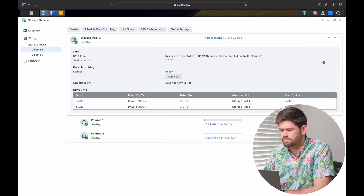Now let's say I'm a bad actor with physical access to the NAS. I've stolen it — I've broken in and walked away with it. What I'm going to do is a soft reset by holding the reset button for five to six seconds until I hear the first beep. Then I'll be able to get into the NAS and all the encrypted data with no problems whatsoever. So I'm a bad guy with physical access. I just held the reset button for six seconds — you may have heard the beep. Now I'm going to wait for the reset to complete and show you what I'm able to do.